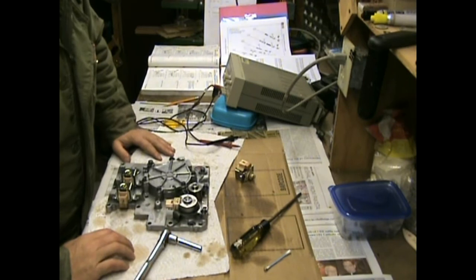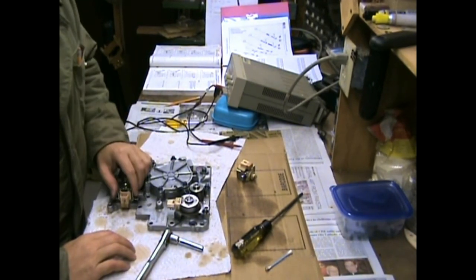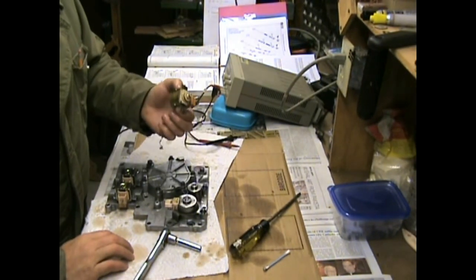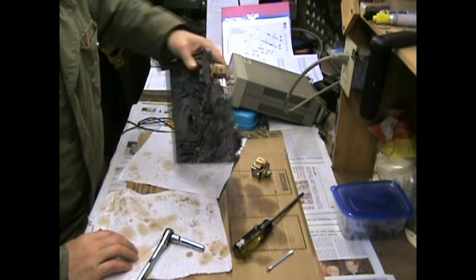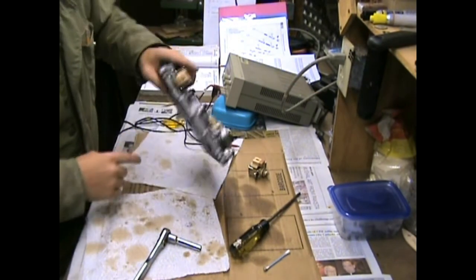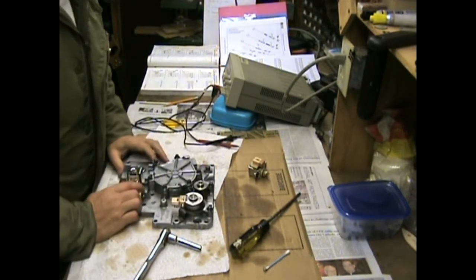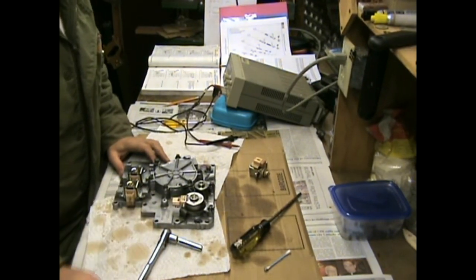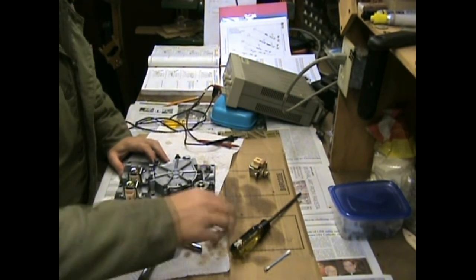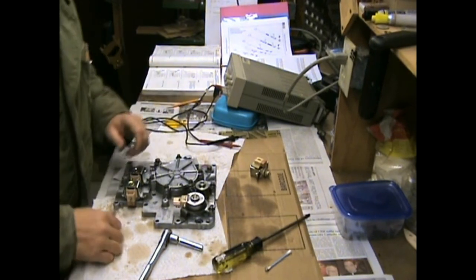I guess I have to say, in the valve body, everything looked okay. We got a couple things. We have the solenoid, which appears to be working, but it's marginal. And we have whether or not this bearing for the pump shaft, which goes into the torque converter, is adequate or not. There's a little bit of play there. I'm not sure how much play it's supposed to have at the moment. So those are the two things that I found, at least doing this piece.